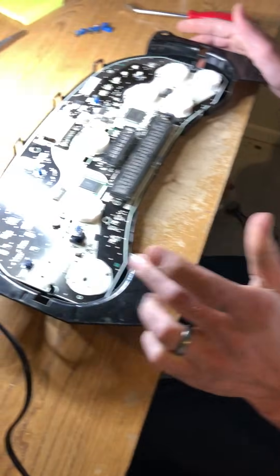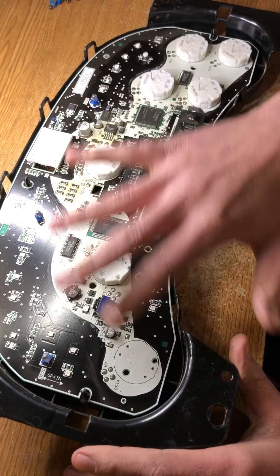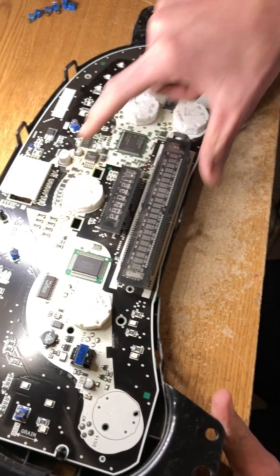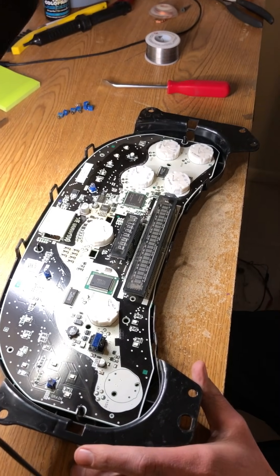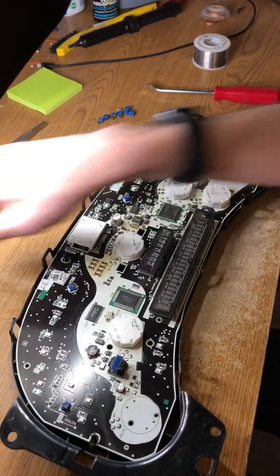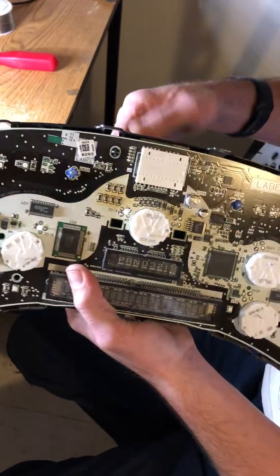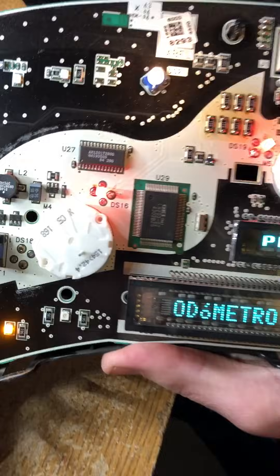Alright, you're going to do that to either these eight, and if you have a trans temp — or even without a trans temp — there's a ninth bulb right there. These need to stay the same; those are not backlighting bulbs. So just these bottom eight or nine need LEDs. I recommend before you put the face back on, plug it into your truck — just make sure you've got all of the LEDs installed correctly. Turn your key on, make sure the LEDs light up. And as you can see, the two that we installed, they do work.